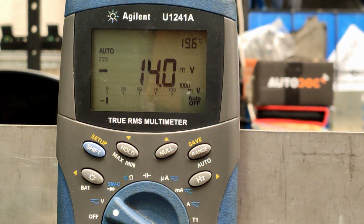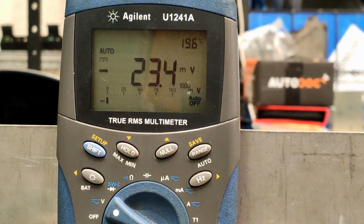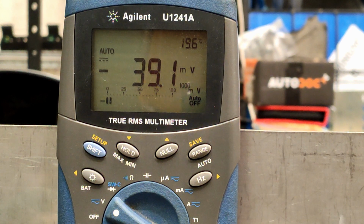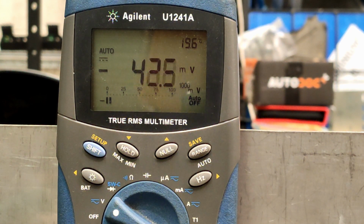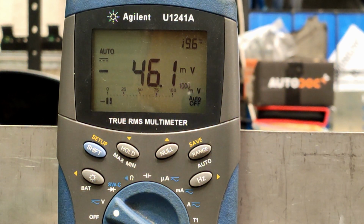When I was reading up about coolant and changing it, one of the reasons given was that it can become conductive and obviously start to cause internal corrosion. One of the tests was to hook a ground up to the engine block or chassis somewhere and then put the positive into the coolant tank. So that's what we have done here. I have no idea what's going to happen.